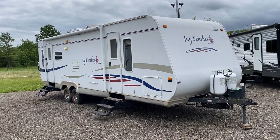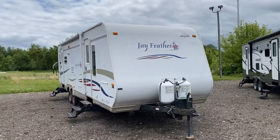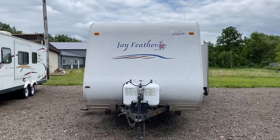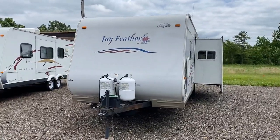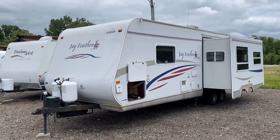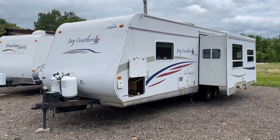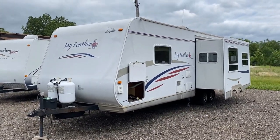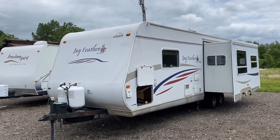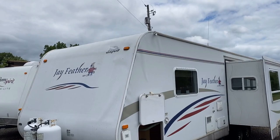I think originally this would have had 20-pound propane tanks and I see some 30s up front there. On an RV like this, one of the things I'd throw out there is to plan on budgeting some money for replacement tires. Typically, as long as the RV rolls down the road, a fix-it-and-flip-it specialist won't touch tires. And given the age of the RV, what I'm seeing looks like the original tires, which means at the very least they would have aged out.